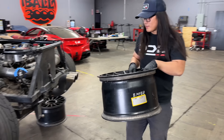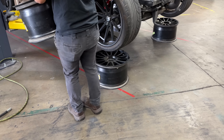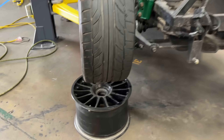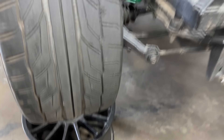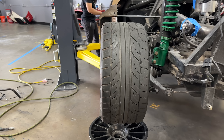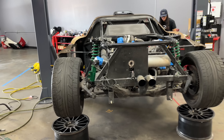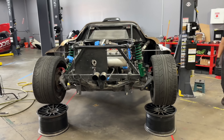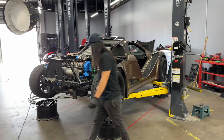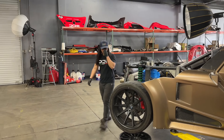We're going to use Dave's wheels — the bent ones. All of them are bent. These are from his GT4 McLaren race car; they all need to get straightened out anyway and the finish is pretty wrecked, so we're not worried about it. We got all the suspension on there. There's still a bit of camber in it, but we put a level gauge on the hub and adjusted the camber to take out as much as we could — it's about one and a half degrees negative right now. We'll see what it ends up when we put the car on the ground. We'll also have to adjust the toe on the rear, and on the front we'll need to adjust the caster, toe, camber — everything, including the ride heights.